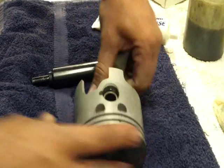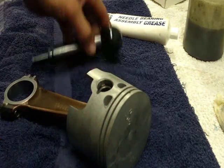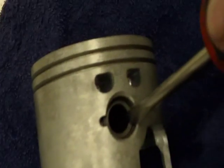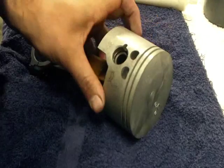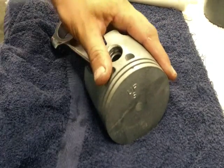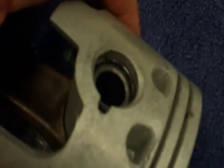Just give it a gentle tap - and there we go, in and done. One thing I always do when installing wrist pin circlips is I push down on the wrist pin hard both ways - push down, turn it over, push down. That just makes sure that you've got the circlip seated in its groove properly. If it isn't seated, you'll be able to push it out.